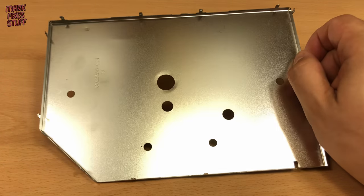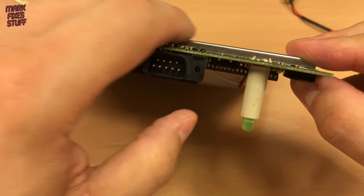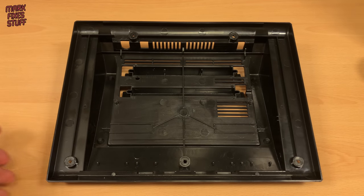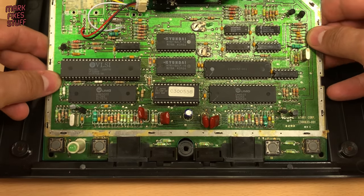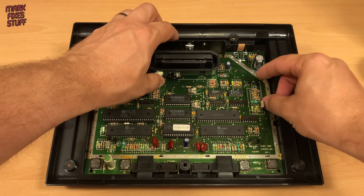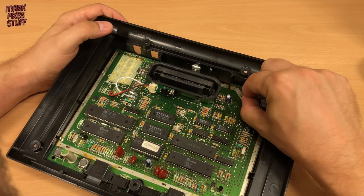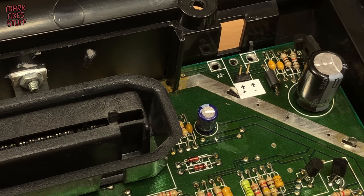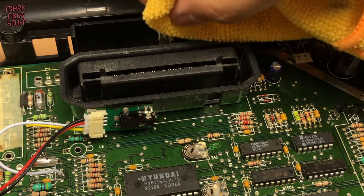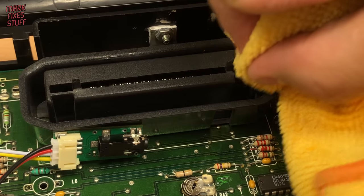It's time to mount our composite mod. Let's put the lower RF shielding on first. With all the shield tabs in place, we can put the system board into the lower half of the console shell. With the Atari 7800, the controller ports and difficulty switches need to be placed into the front of the case first, and then the board will simply lie down in the perfect position. Just to be a bit tidier, I've made a sticker showing the polarity of the power pins on the board. Now I like a pristine slot and this one looks a bit mucky — we'll clean around the slot and the contacts inside will also need some attention.